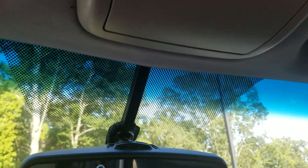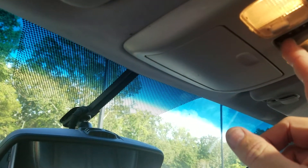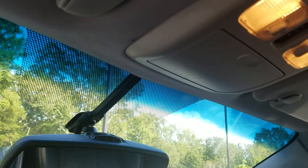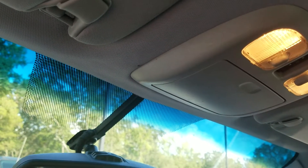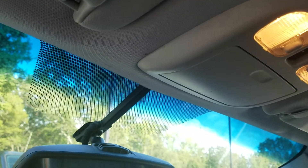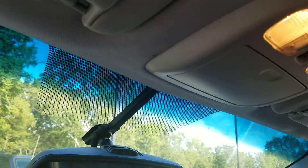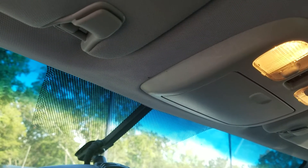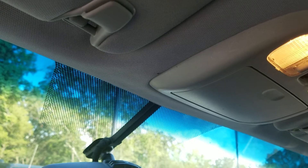So it's a little weird. What do you do? You have to have the front door open. You turn the key on, press vent until it vents, then let off. Then within five seconds you turn the key off, back on, hit vent again, let off, hit vent again and hold it. This one's not going to go out through the whole motion of the sunroof — it's just going to max itself out at the most vented position. It'll kind of go bump bump and then you're done with that part. But then you have to carry out five complete cycles of the sunroof. A complete cycle is open, all the way back to vent, and back closed. So you have to do that five times for it to fully relearn. So let's do it real quick.